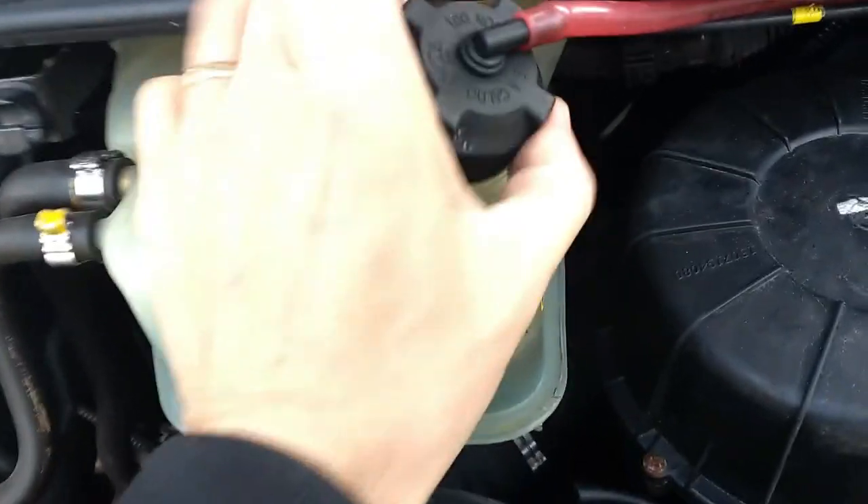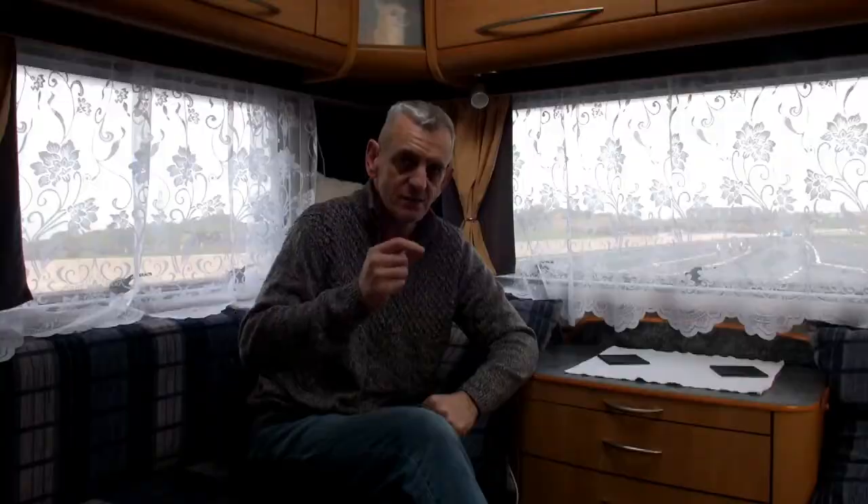To check, take the lid off, put your finger in and have a look — feel it, see if there's any oil there. If there's oil in there, there's a crack in the cylinder head. That's the reason that oil has seeped into the water.